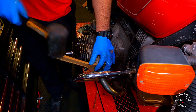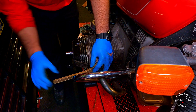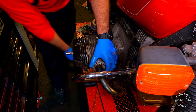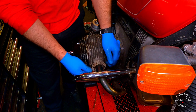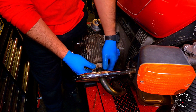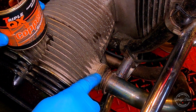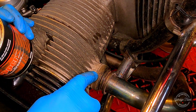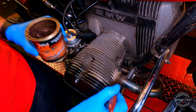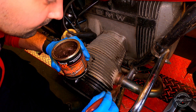One thing I noticed on this bike is that one exhaust has a slightly newer and different shaped nut than the other one, and there's just a tiny groove visible underneath it — so the nut on that side has been cut off, probably because someone couldn't undo it. I've also noticed that the threads seem dry, which is not a good thing because they do tend to seize if left dry. So I'm going to remove both exhaust nuts, put some copper anti-seize on the threads, and then put them back together. It's a small job that wasn't requested, but I think it's worth doing to make things easier in the future.